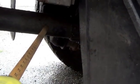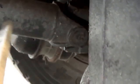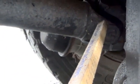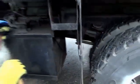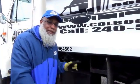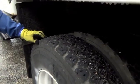So we'll start underneath the vehicle with the drive shaft, universal joints, and the rear differential. It's not cracked, not broken, and secure. No illegal welds, no debris wrapped around the universal joints, and no leaks from the rear differential. Now, you don't have to get underneath the vehicle, but you just have to be able to know these parts. You got to be CDL minded, because now we're getting to the rear axle here, and we're not going to be able to get up in this. So you have to be able to be CDL minded here.